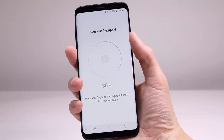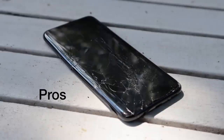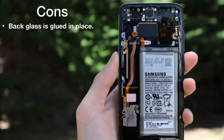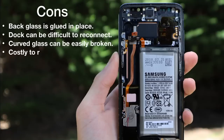It's now looking brand new and all functions are working including the fingerprint reader on the back. In terms of repairability: the headphone jack is removable; the fingerprint sensor is replaceable and will still function after being replaced, unlike the iPhone; the battery uses standard removable adhesive, unlike the iPhone; but the glass is glued in place on the back which makes opening the phone difficult. The dock connector can be difficult to reconnect as it's located on the bottom of the motherboard. While I love that the glass is curved on both back and front, it does make the phone more easily breakable, and with OLED screens costing around $200–$300, this phone is quite expensive to repair.